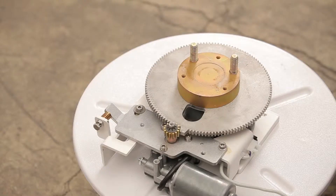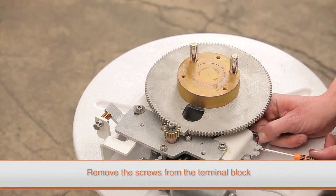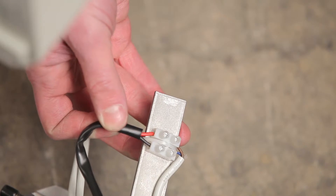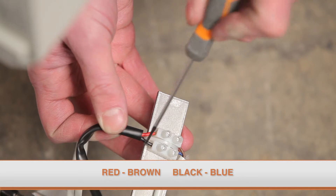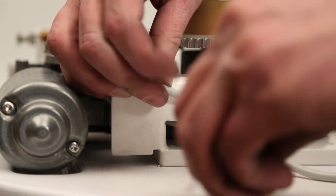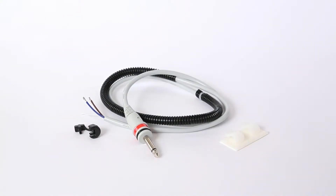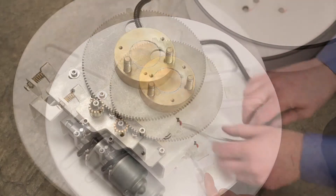To replace the motor cable, loosen the two screws in the terminal block with a small flat blade screwdriver, then remove the cable end. Connect the end of the cable to the terminal block making sure that the red wire from the motor is matched to the brown wire from the cable, and the black wire from the motor is matched to the blue wire from the cable. Then securely tighten the terminal screws. When replacing the motor cable on the splash lift, follow the directions included with the replacement cable kit. Routing the cable in this manner will help prevent the cable from being entangled in the gears.